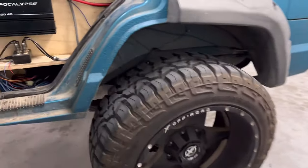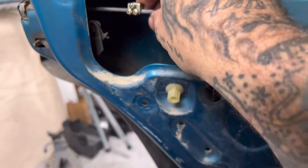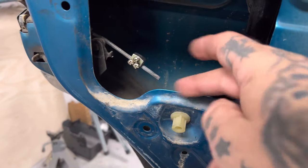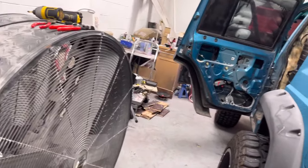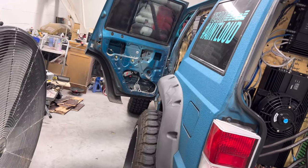So my shit's locking and unlocking, except for this driver front door ain't doing nothing. I got to remake my rod that goes from here to up here — I might flip it over and put it on the bottom because it was pushing the rod out. I got a new rod here that I need to mark, bend, cut, all that. The polarity was wrong on a lot of it. I swapped all them. Now I got to dig in that front door. The alarm works, and after that I just have to go in and probably adjust my shock sensor.